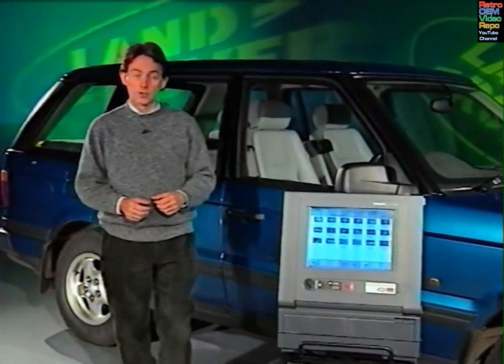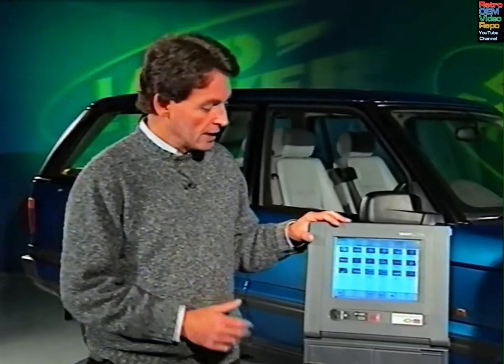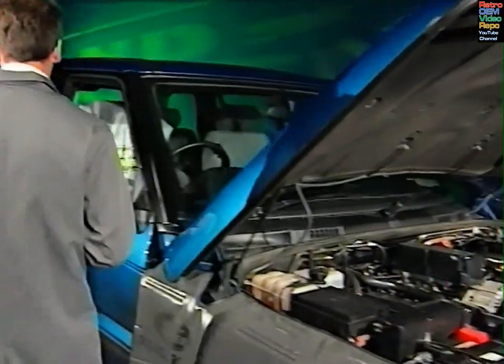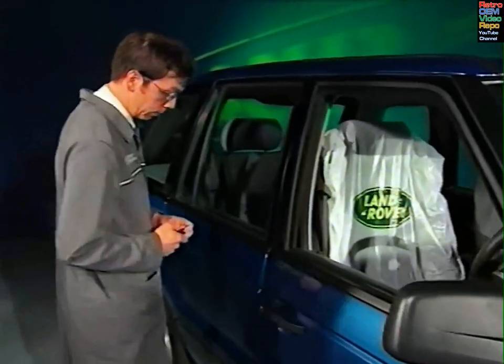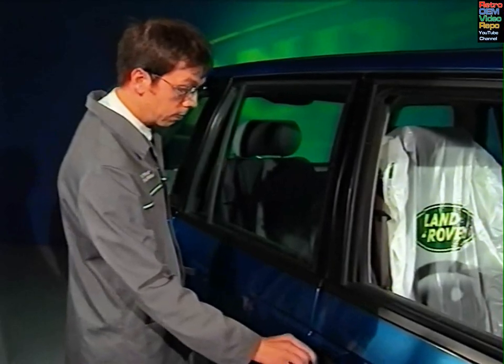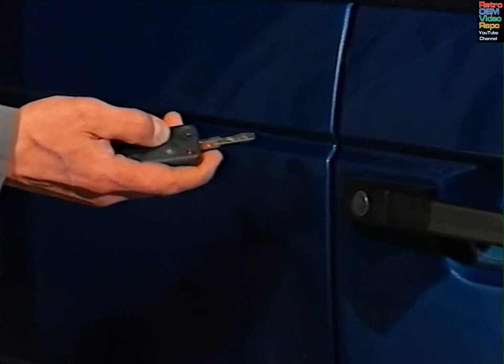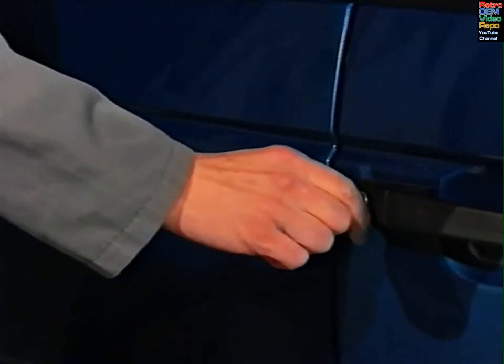Fortunately, Testbook can break the system down into its component parts and test them individually. The menus clearly show you the vehicle systems and let you monitor their performance via the BeCM. So let's see how we would diagnose a Range Rover which refuses to remobilize. After replacing the battery, an attempt is made to synchronize the remote by pressing the lock button and then turning the key in the lock direction. The light on the remote flashes correctly. However, the remote then fails to operate on the vehicle.